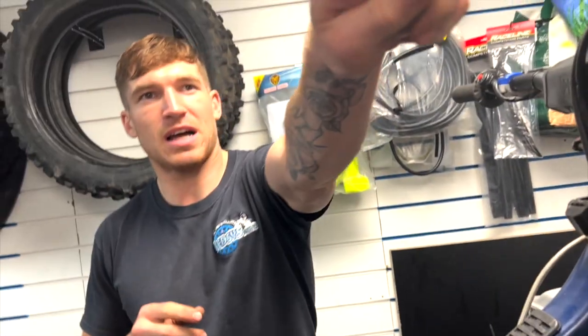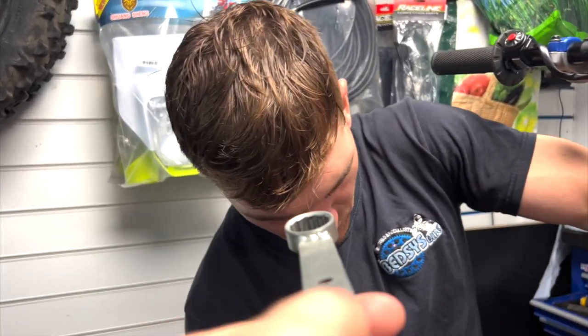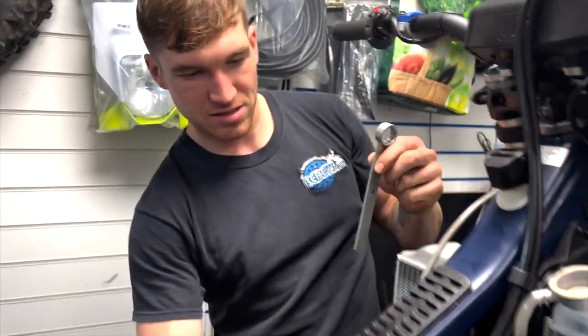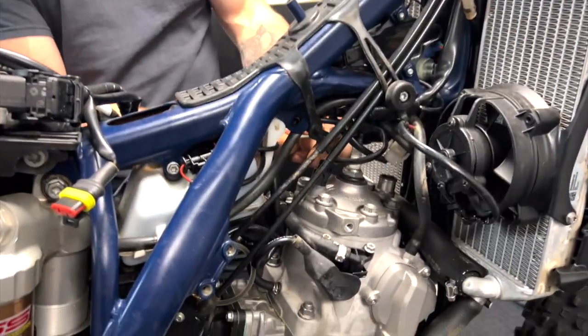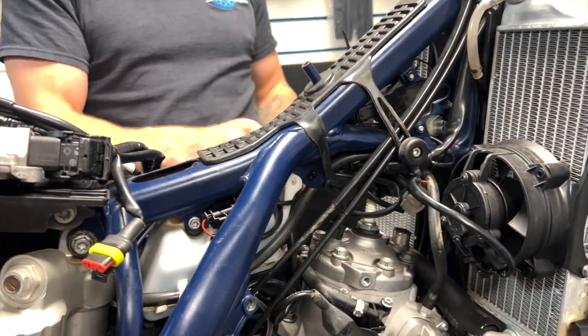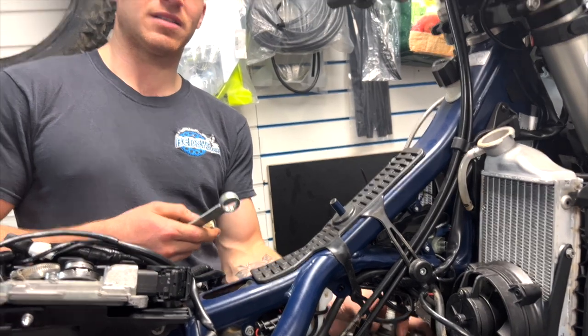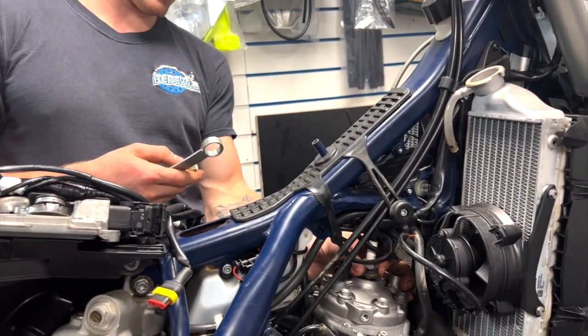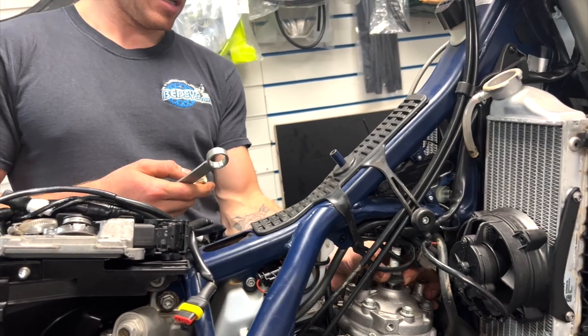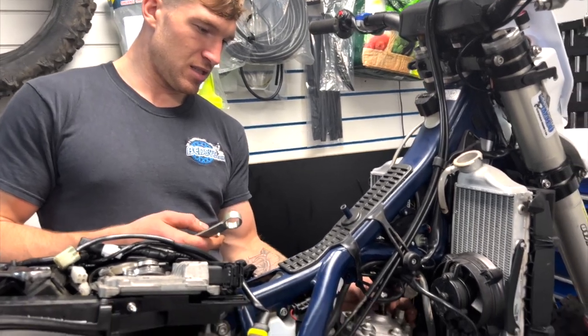Daniel, would you pass me that spark plug spanner there, please? This spark plug spanner. Oh, she's in there. Everything's nice and fresh still, which I like. Nothing better than working on a freshie. Do you know what I mean, Dan? I know what you mean. Yeah, and then we'll remove all these 6 bolts and then fit the new gaskets, fit the new head on, and be very happy boy.